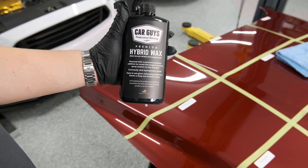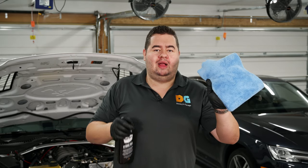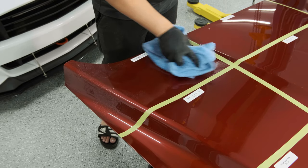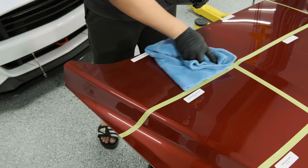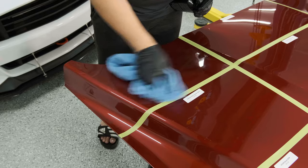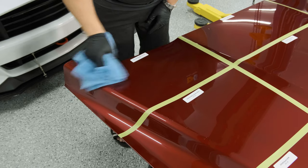The first test today is the Car Guys Hybrid Wax — brand new unsealed bottle, never tried it before. They claim it's boosted with patented polymer technology creating the longest-lasting spray sealant on the market. Instructions say spray a two-by-two foot section and wipe off using a fresh side of towel. It's spreading around well but not wanting to come off easily, and there's a weird hazing I don't like. This is our cheapest product at $6.25 per pint based on the largest Amazon multi-pack.